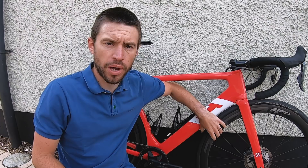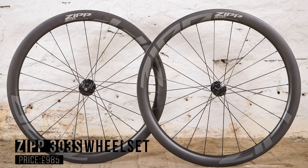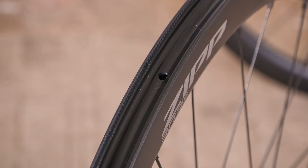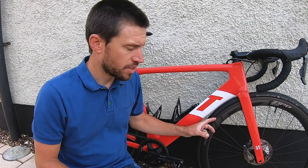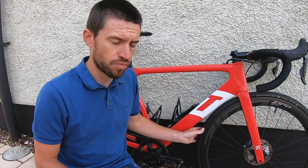The wheels on the bike here are the new Zipp 303S. They are using a brand new rim from Zipp — disc only tubeless with hookless or straight-sided tubeless rims. As a wheel set they weigh 1550 grams, split as 718 grams front and 832 grams rear. Those are the official weights and they're actually accurate. Depth is 45 millimeters. These are replacing the 302 disc brake wheel set and will be available in XDR, Road, and Shimano HG 11-speed.